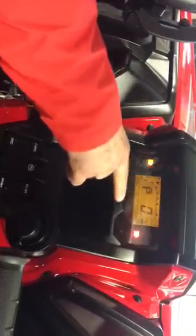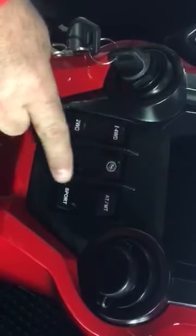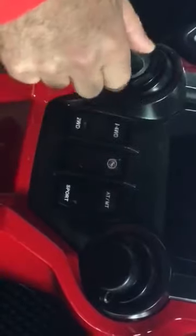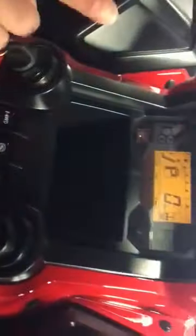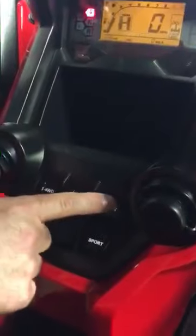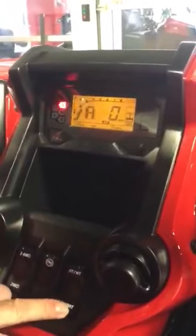The gauge has a tachometer, gear position, clock, and here are the buttons. So we have 3 ride modes. Okay, you have automatic with sport, or manual transmission. So when the unit's running, it always starts up in automatic. If you were to select another mode, it would have to be in gear, and there I would hit it, and that would be manual transmission. If you hit it again, you're back to auto. If you hit down on sport, there's sport. Sport only works in automatic.